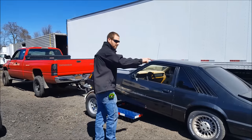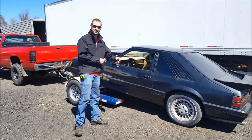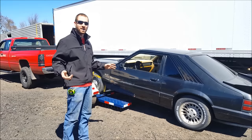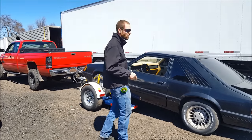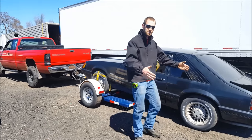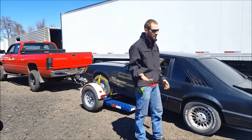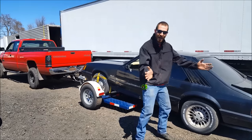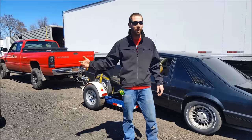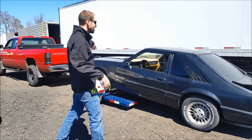I've seen people put rear-wheel drive vehicles on here backwards. You can't do that either — you can do it if it's local and you're doing 10 miles an hour through a town, but if you hop on the highway going fast, you have all this weight in the back of the vehicle. Not to mention you might have some sloppy suspension components. What's going to happen: this thing's going to go into a sway and you're going to lose the car. That little two-inch ball, that thing's going to rip off — it's going to fly in these straps. No good.